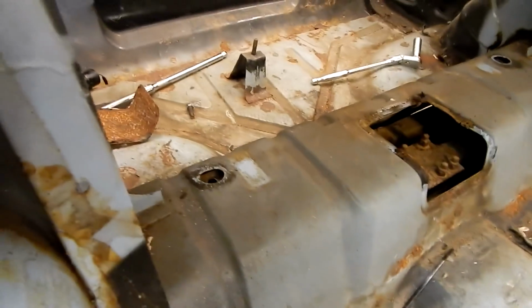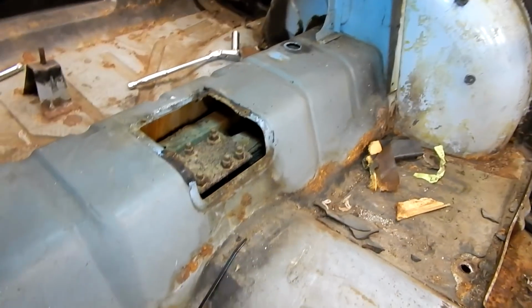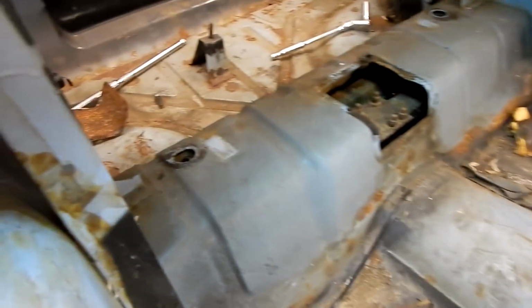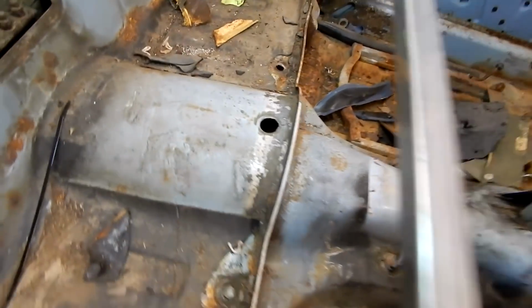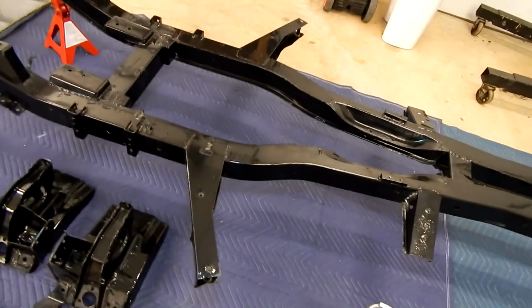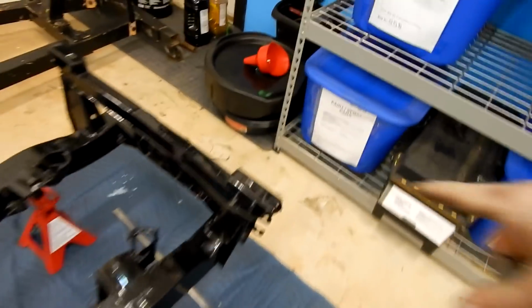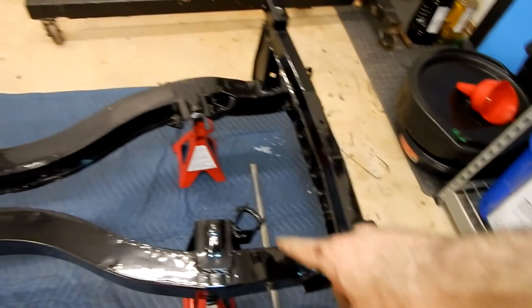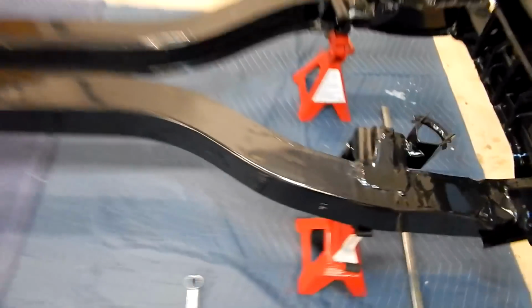So, all right, so we're making headway. We went ahead and removed the 2 bolts on either side there. We did remove that center plate. That's just the attachment point for the spring pack. The reason we removed it is after we removed these 2 back ones, it still wasn't wanting to lift in the back. What we ended up finding was under this kind of sound deadening material were 2 more bolts. And one thing that was very handy, since we have this frame over here, we were able to kind of check. So here were the 2 front bolts on either side. Here's the midpoints. And then here's those parts up in the raised area. But what we didn't notice right away was this piece right here, and that's where those other 2 bolts thread in. So hopefully we take those out, and then we'll see if the body will lift.